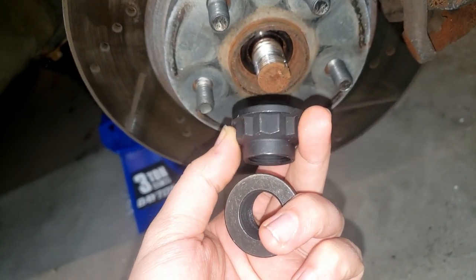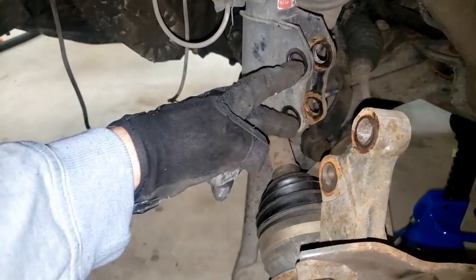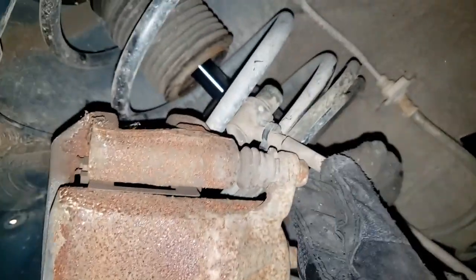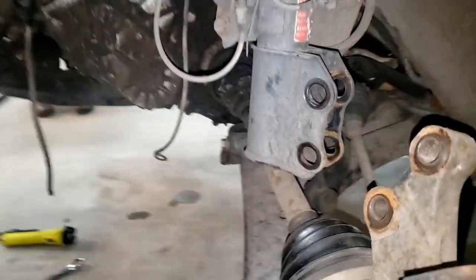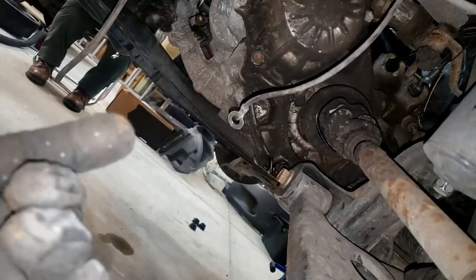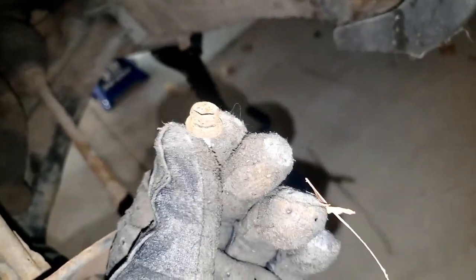I know you can reuse them but it was like seven bucks so I can afford that. Got the lower two bolts from the strut off, got the brake caliper off and hung up here by the bolt — just put one of the bolts back through the hole just enough to hang it off the coil. The ABS sensor is tucked up here as well, nice and safe. The axle is loose, sliding forward and backwards, so what I need to do now is go get a crowbar, put it in there, and get it to pop out towards me. Hopefully we'll get one axle out and then I'll put these bolts back in and tie everything back in place, except for the bolts that are disgustingly rusty — those will get cleaned or replaced.